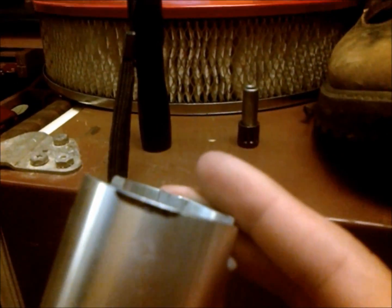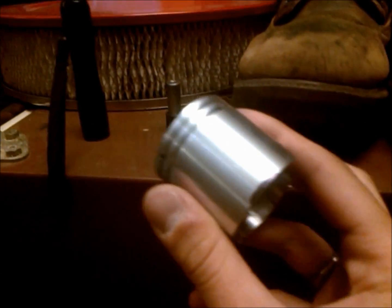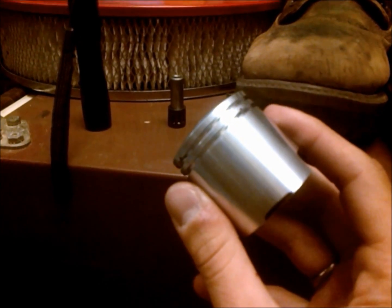So, and this will definitely be a problem if you have anything that's a bigger spaced gasket here below the jug. You'll have to grind more out. So that should help performance a little. I'm going to go ahead and do that, and then we'll check back.